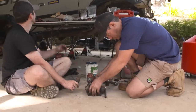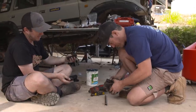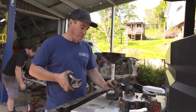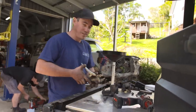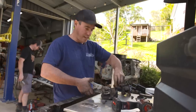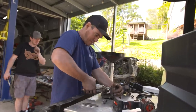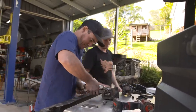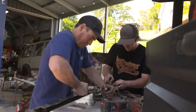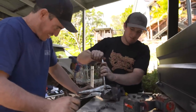With the bearings replaced, it's time to start looking at the brakes. We've got slight movement on the calipers - that's good news. But we went around with these calipers for the rear and they're a little bit seized, so we've actually got a rebuild kit for the calipers. It's a messy fiddly job but we're going to give this a crack. Normally you'd use compressed air and the piston would come straight out, but we don't have compressed air in this garage - so we need to get a good grip on it. It's in there - not moving. Leverage wherever you can.